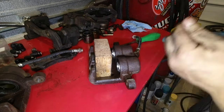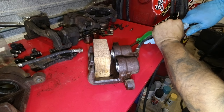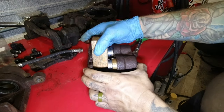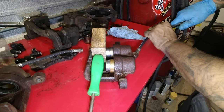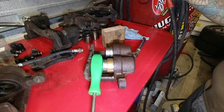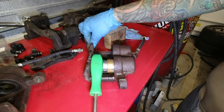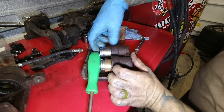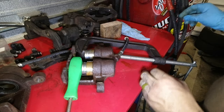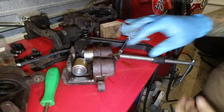I will use compressed air blown into this brake hose to extend the pistons, as seen here. Now with the two-piston caliper setup, it's very rare that they'll both come out at the same time. And if one comes out, then you have no more pressure to push the other one out, so you kind of have to trick them. Kind of like that, one of them came out. Now put the other one in just a little bit and find a way to hold it — I like to use a C-clamp very loosely placed on there. Remove the block, blow the other piston out, and then you can go back and remove the first one by hand.